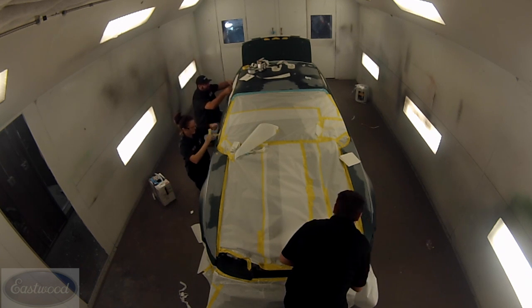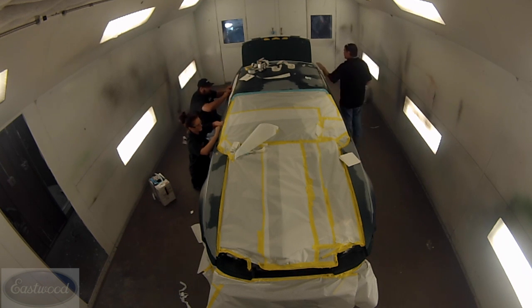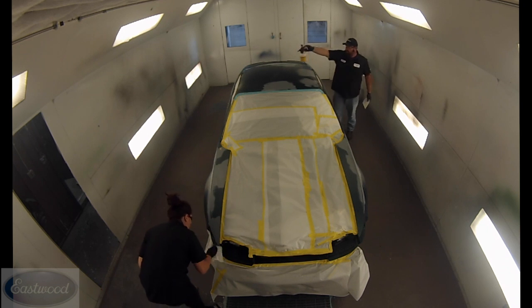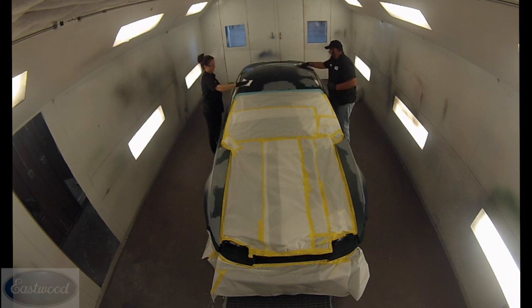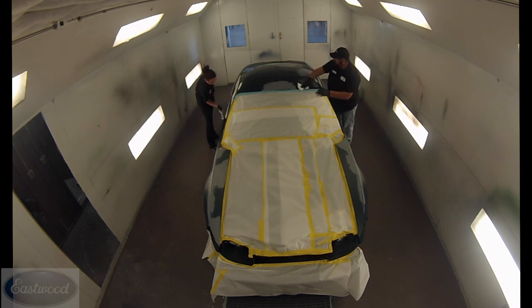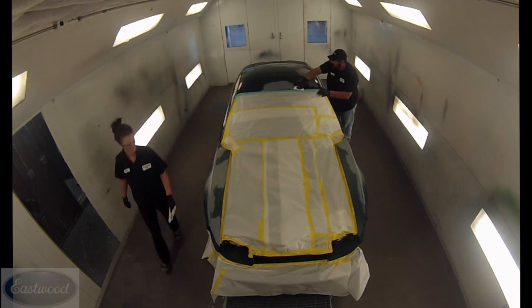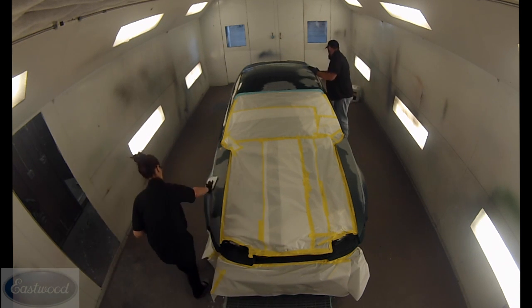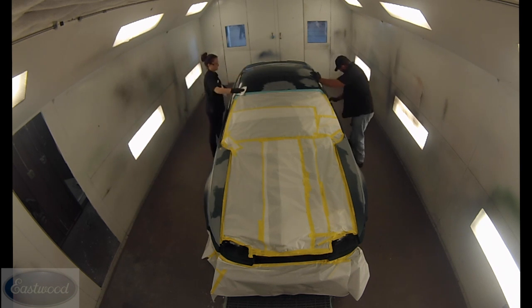This footage I've had for a while — just now getting time to edit it and get it posted. This job has been done for a long time, I'm just running behind on the editing. Okay, we have got it all masked off. We went around and made sure everything looked good, cleaned the booth, cleaned everything off the floor of the car. Wiping it down — notice they have gloves on, because from this point forward you do not want to touch the car. Your hands can contaminate the surface. So we're going to wipe it down again, tack it, and now this car will be ready. We're going to seal it, base coat it, and clear coat it — we're finally going to get to those stages.